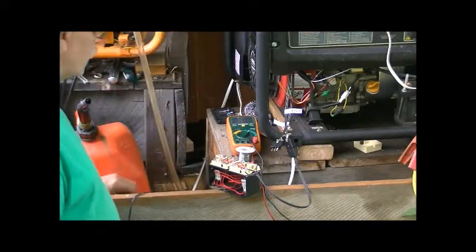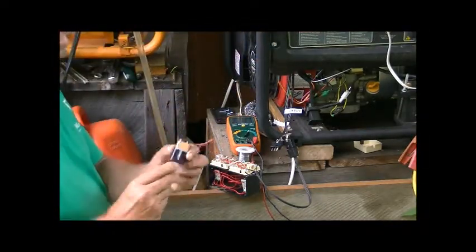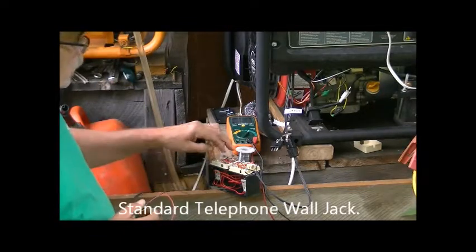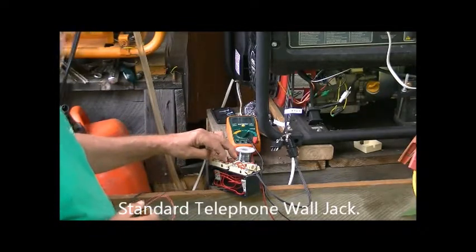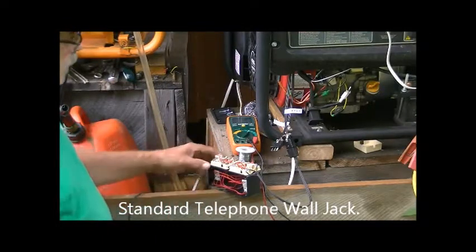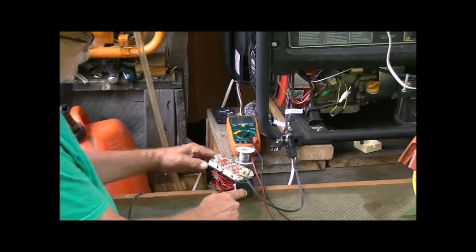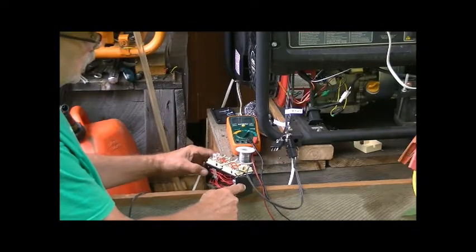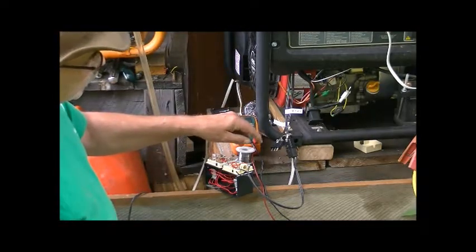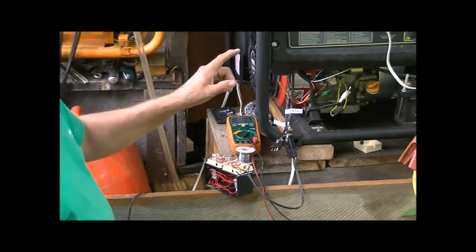I'll have to take it back off once it starts. An old nine-volt transistor battery — I'm going to touch on these two bolts here, these contacts. That's going to trip a relay inside here, and that relay is going to trip the starting solenoid.